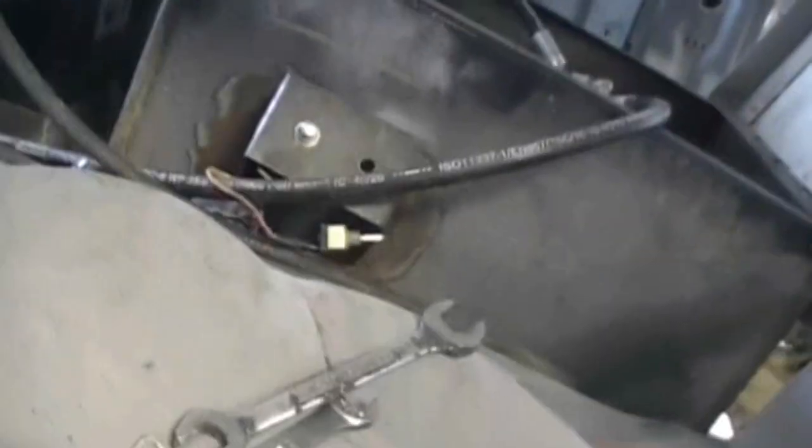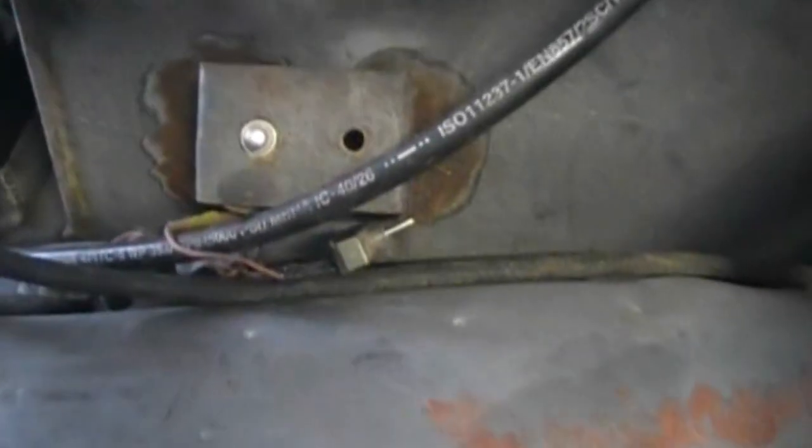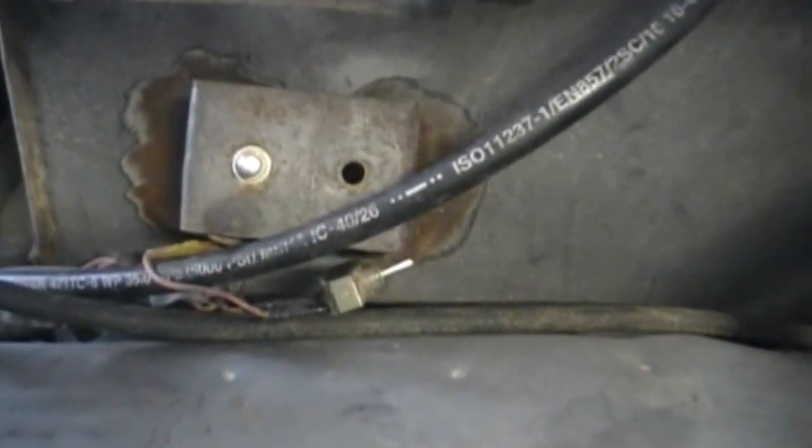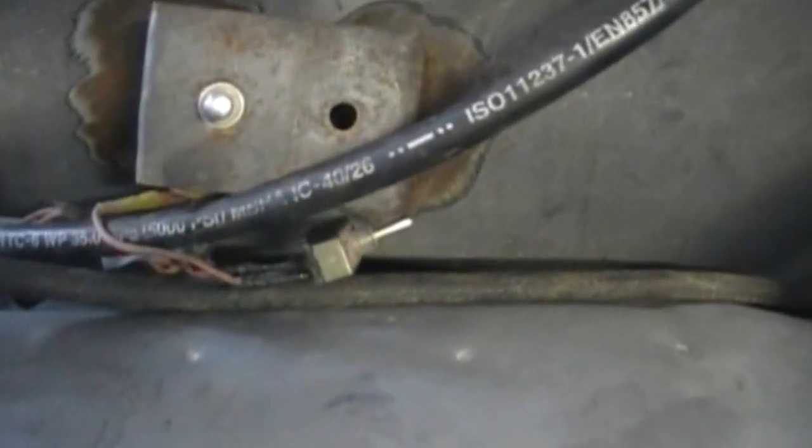My wires are hooked up. It's actually been run. Just ran it by pouring gas in the carburetor, filling up the float bowl, enough to heat the motor up. My wires are coming off the switches, so I might solder them, or we'll see. Maybe I'll just tape them really good again. Gonna have to get some adapters to hook up the trans lines because I've changed it. Went from hard lines to rubber lines.